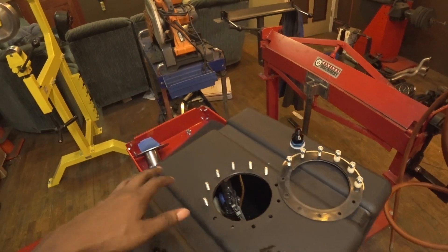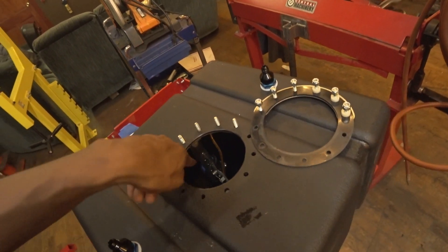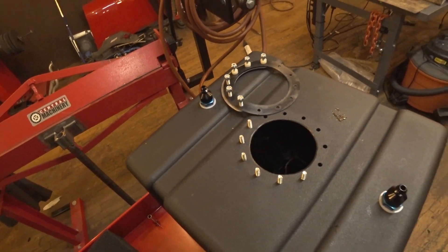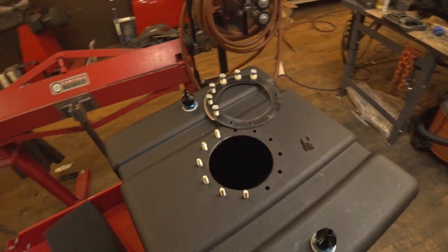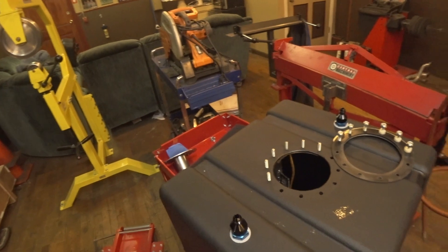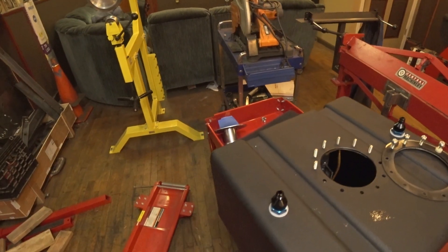The fuel pump is inside the fuel cell. We made a little bracket that mounts the fuel pump along with the OEM fuel leveling system, so that should be able to have a correct reading on the tank. If I have to put some resistor in line we'll do that, but so far you have something that's compatible with the OEM gauge. That should be really helpful.